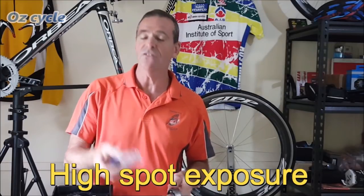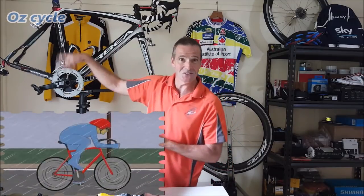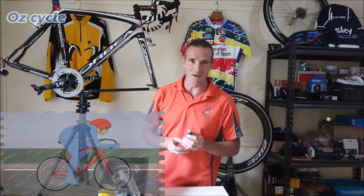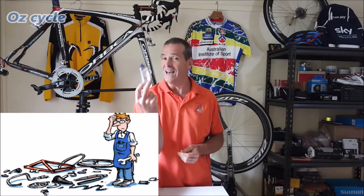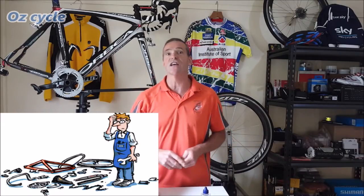This brings out how important it is to have the right viscosity of lubricant. Using a light lubricant also requires very clean conditions. What do we know about the bottom bracket area? All the muck runs down your frame and into your bottom bracket, and your hubs are no better because they're open to road spray. Less than ideal conditions for ultralight lubrication. Using light lubrication also requires more frequent cleaning and re-lubing. Unless you're prepared to take apart your bottom bracket and hubs every 10,000 to 15,000 kilometres, don't go there.